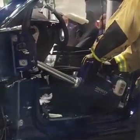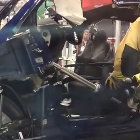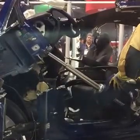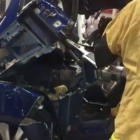Here we have the ram in place against the B-pillar and we're starting our dash push. The Model X is equipped with a dash bar that runs from the lower A-pillar on one side to the lower A-pillar on the other side. Often when doing dash displacement we need to move our ram into that dash bar. With those great relief cuts we get a lot of movement out of that dash bar. Now the guys are going to bring the spreaders in to hold that dash up and out of place so we can remove the ram and create good access to our occupants.